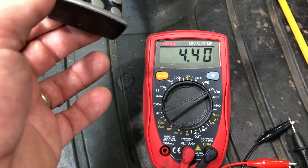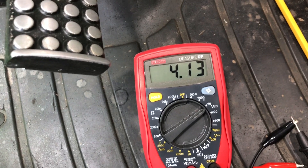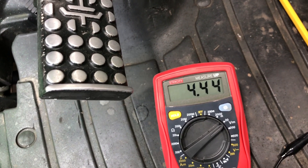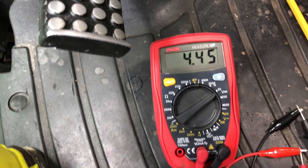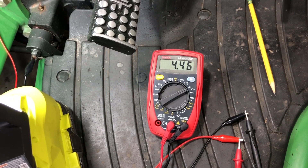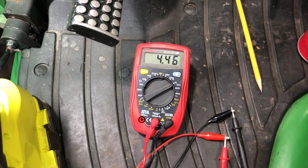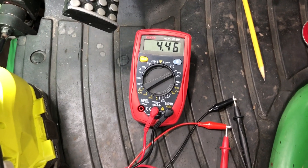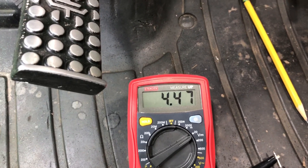I'm going to move it left to right now and see if I can get it to do that weird voltage thing again. You see right there — I'm not pushing down on the clutch at all, I'm not in it — and it's getting a fluctuation down to two volts just by moving the shaft a little bit left to right on the variable switch. There's obviously a spot on the positioning of that switch arm where, if you wiggle the shaft side to side, it's not a steady consistent voltage. That's enough to tell the machine to stop.